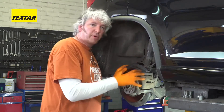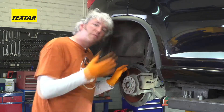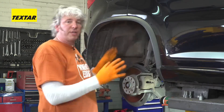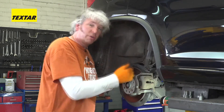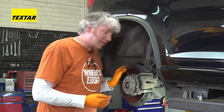When it comes to actually changing the brakes on a car like this, people have tried all kinds of different fiddles just to avoid buying the correct EPB service tool, but really it's just not worth the bother. There are all kinds of safety features built into the car, which means that at any moment, for no particular reason, the EPB could be operated, therefore crushing your fingers potentially. That means you may lose your fingers, but also your job.